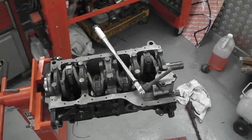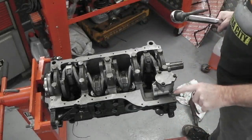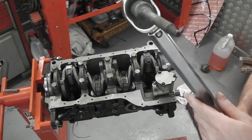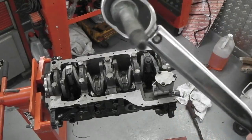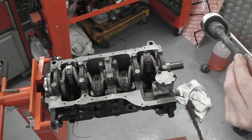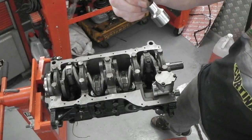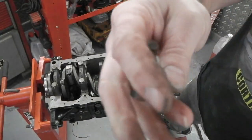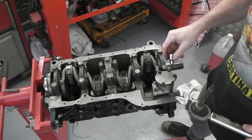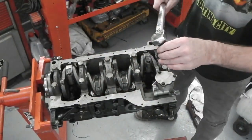Let's go. Okay, oil pump to the splines. There's two spline bolts here you've got to use to get in. This tool, don't ask me where I got it, I have absolutely no idea, but you could get that spline Torx type. If you're doing your oil pump, it's an M8, but a normal socket size won't quite get in to do the oil pump. I didn't know this. I'm learning today, by the way.